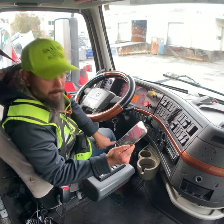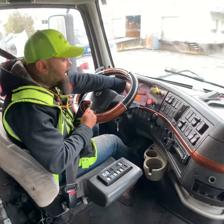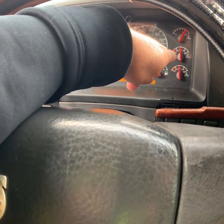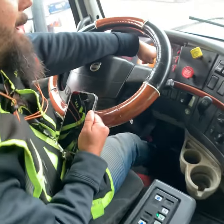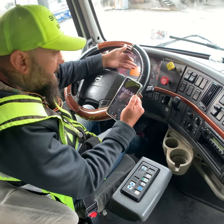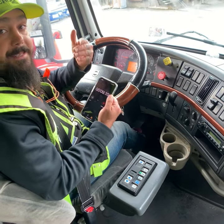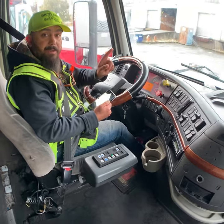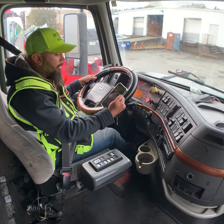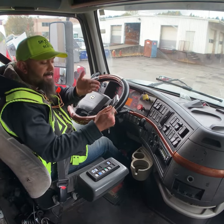After that, I push and hold my service brake. After that, I am waiting for the needle to stabilize. A little wait. After that, say now the needle stabilizes, my test begins now, or my time starts now. When we say the needle stabilizes, it means the needle doesn't move anymore. You have to look at here, the handle pressure. When you see 57, 58, 59, 60.